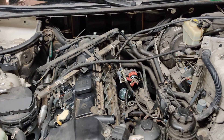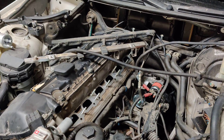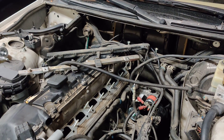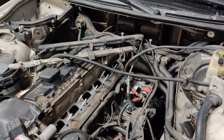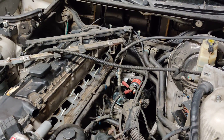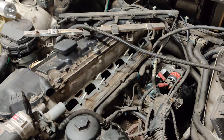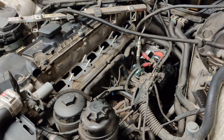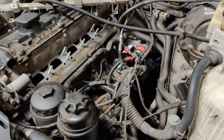If your Google searching has landed you here, hopefully this video is going to help you. If you're working on a BMW straight 6 — I don't know all the vintages, but this is the E46, 99-05 or whatever — I'm going to assume the M54 engines are all probably similar. I've got the intake off; I had to pull it for a failed PCV system, or oil separator system, or whatever you call it. I'll show you what I think I know about how that system goes back together, and then the vacuum hoses and stuff.